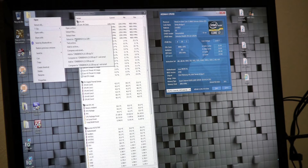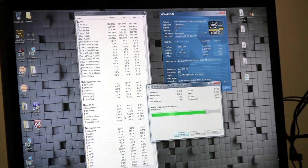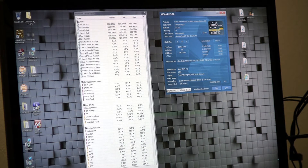Let's step up to something a bit higher. Opening an extracted folder to do some processing, we can see the CPU jumps up to 4.8GHz. We're still only peaking at about 65 watts, and of course we still have web pages open. The benefit is the system is running very quiet, effectively doing its job in terms of sufficient cooling performance. Our peak temperatures haven't really gotten that hot — 52°C, 48°C, 47°C, 49°C — with our current normal frequency in the low 40s.